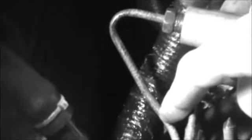Well, now who bent this? Alright, so when I pulled this out, I accidentally bent the line a bit. Make sure not to do that. I was able to carefully bend it back, but if you bend it too far, it's gonna kink or snap. And if it kinks, well, no fluid's gonna go through it. And if it breaks, your fluid's gonna come out and you're gonna get air in your lines. Then you have to redo this all over again.